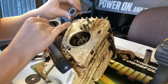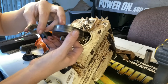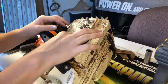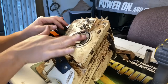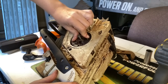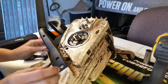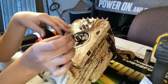When putting the clutch back on a Stihl chainsaw, your worm gear has this little rod that pokes out right here. Whenever you put your sprocket back on, it's going to have to go into this little notch right here on the sprocket. Put that back into place, put your washer down. Lock the piston in place again, tighten it, and then take your rope out.